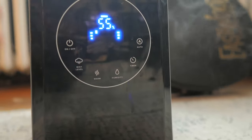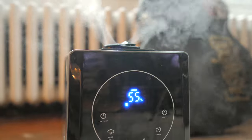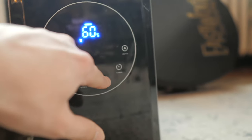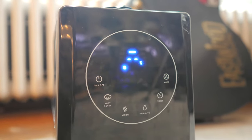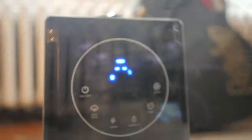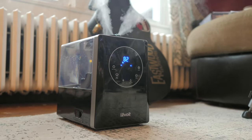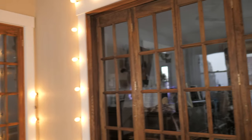Theoretically you'd set the humidity to 55%, but the unit thinks it's at 90% right now and is about to shut off — I can tell you it's definitely not at 90% or even 55% in here. So I just run it all the time, and if it gets a little too humid in the room I'll turn it off for an hour or two and open the doors to the rest of my house to help equalize. I don't use that humidity function at all. It does have a timer and auto on/off — you can set the time of day you want it to turn on. You want to make sure you're in a smaller to medium-sized room; this is about 150 square feet and you want a way to close it off from the rest of the house.